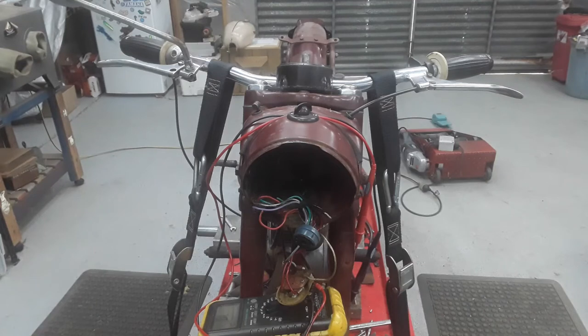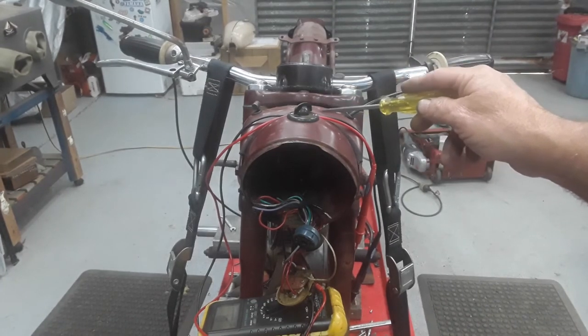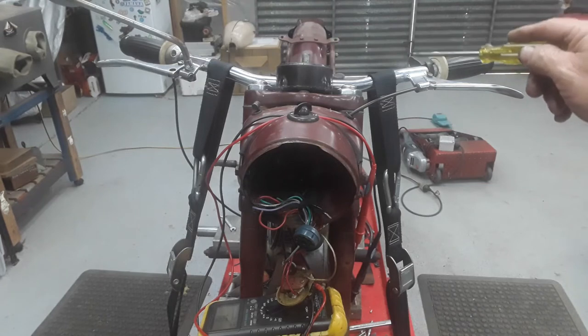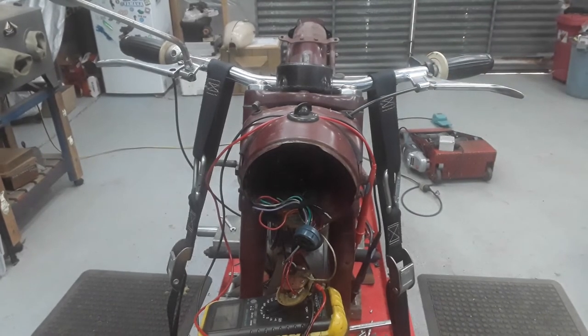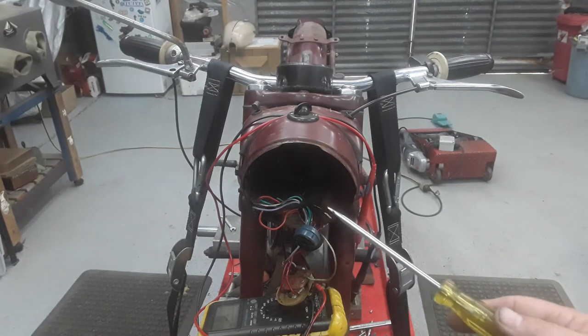All right, so we've isolated what our tail light issue is, and our tail light issue is this switch is broken. So in the internals of the switch, it's not providing a power supply all the way back to the tail light. Now you'll see over here, they've actually put a high low beam switch on there. So this switch is actually high low. So I think at some stage the switch is broken and they've fitted the handlebar mounted switch. So right here, they're the two feeds. One goes off to your tail light, one goes off to your speedo light. So I'm splicing it into the power feed, which is this line here, which comes from the switch and over to the handlebar switch. So hopefully we'll get all the tail light working, but other than that, so far so good.